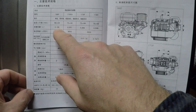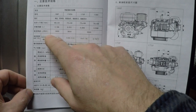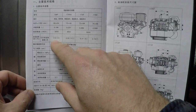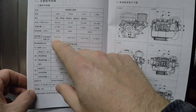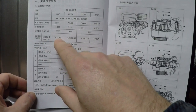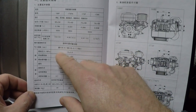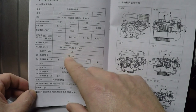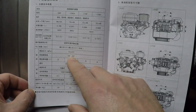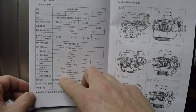Bore times stroke, 196 cc or 0.196 liters, revolutions per minute is 3000 rpm. And at that, it should be generating 2.2 kilowatts or around 3 PS, which is roughly 3 horsepower for the 168. I'm not sure what that is. This, I'm guessing, is injection pressure, timing, possibly fuel here,